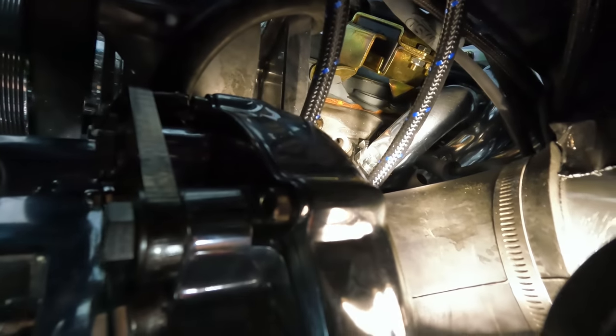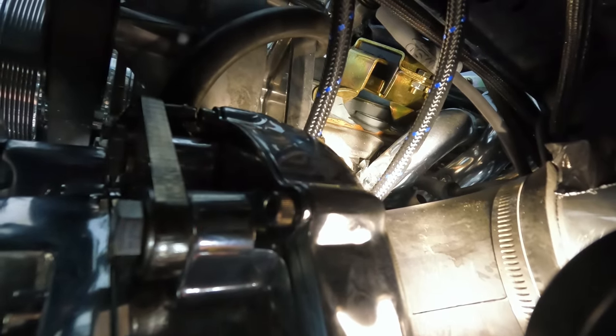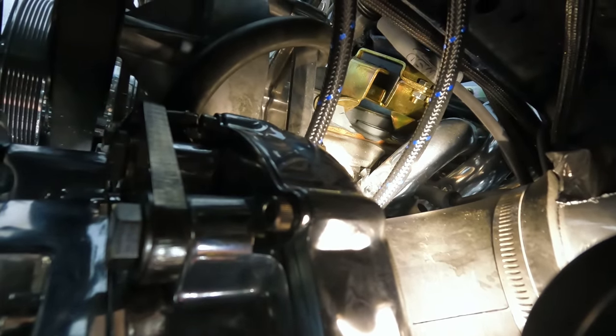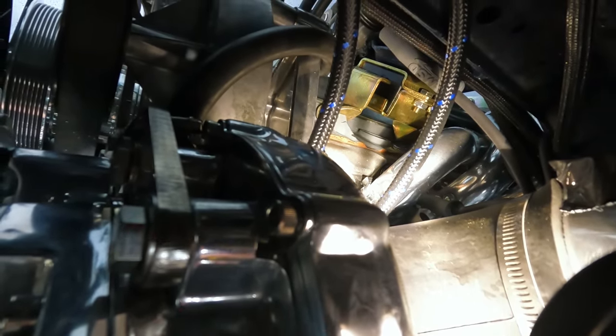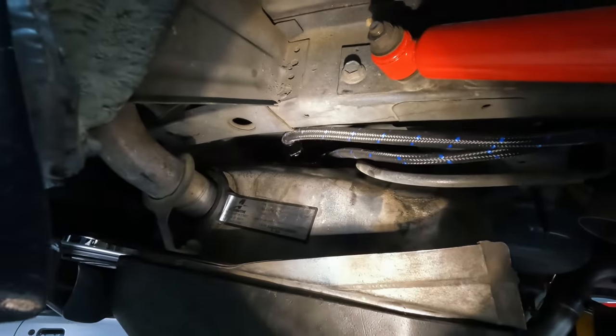Moreover, if you guys want to get really technical, look down in there, you can actually see the top of the piston sitting pretty much right at the top. So I'm going to go ahead now and thread the number one spark plug in, just to validate that the piston is at the top at that marker, so we should be good. So you need to be conscious of that.